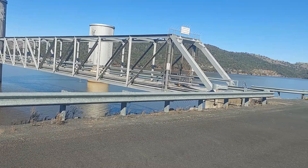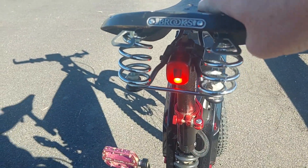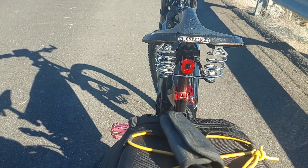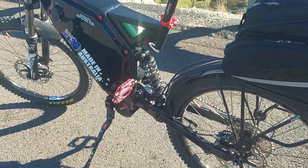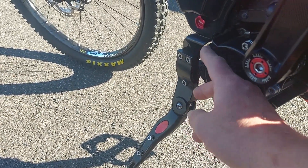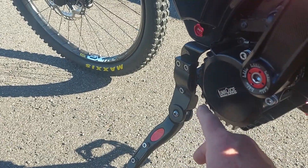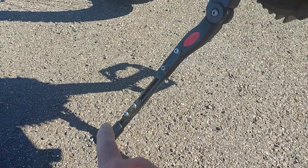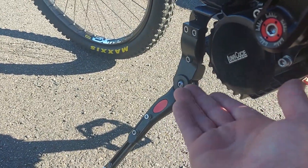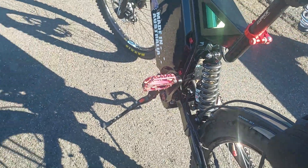Number one it gives me more range, number two I'm not worrying about battery fires at all. I've got a brake light which comes on with a gyro-type sensor — as you brake the light comes on and gets more intense; at night it changes automatically. I also modified the kickstand — made a heavy-duty bracket because the last one after four years started to bend. I made it 4mm, put a triangle formation between the right angle and fully welded it, then extended the kickstand down by about 50mm to raise the ground clearance, and it holds up well even with all the panniers on.